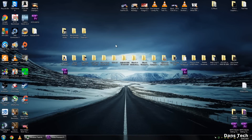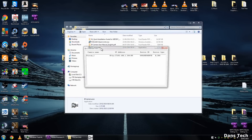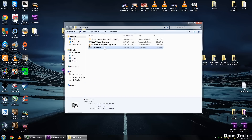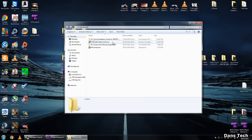Moving on to how to install the software and use it: first, put the disk into your disk drive, or you can download the software from the website. The first piece of software you want to run is called IP Camera Tool. Double-click it and you'll be presented with what cameras have been detected as plugged into your router, and you'll be given the IP address. In my case it's 192.168.1.100 on port 88. You'll also have your device ID and device type, which in this case is H264 - that's the video stream. You'll want to remember that when installing the Foscam client software.